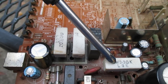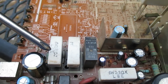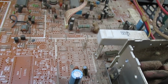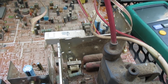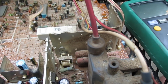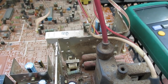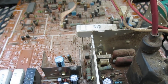This 3.3-ohm fusible resistor is okay. But we have two resistors that have gotten so hot that the values are no longer visible on them — one measures about 330 ohms and one about 470 ohms. I believe those are the dropper resistors for the standby power supply, which are active as long as the set's plugged in. So we know the fuse and fusible resistor for the main supply are good, and the horizontal output transistor is not shorted. Next we need to apply power and probe for voltages — roughly 5 volts to control the microprocessor, and around 9 to 12 volts to energize the relay coil.